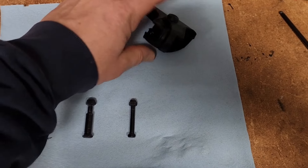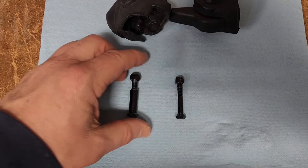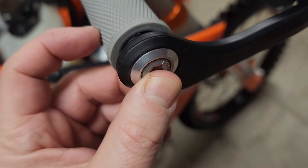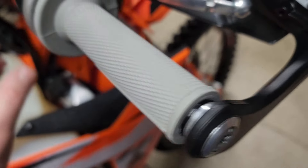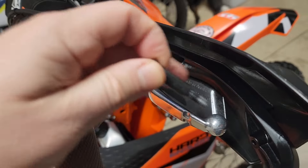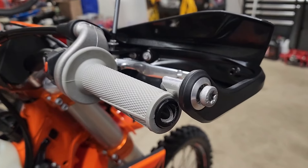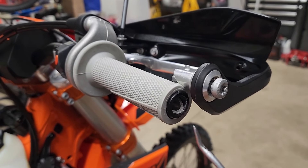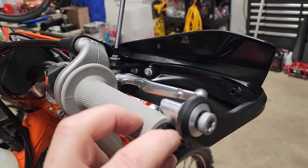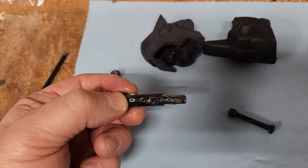Make sure you find your little rubber goodies that came with your bike — they'll usually be in a sack that came with the bike. Then there are the shorter bolts, because the longer bolts go on the perches that come on the bike. Now it's just a matter of taking these handguards off — we're going to take the perch bolt out, put the shorter bolt in, take this out and put the little caps in the end, then shift things around to accommodate the brackets for our new handguards. Here I am removing this bolt, and then after removing this handguard I'll put the thicker one in. Be sure to grease this bolt with some quality grease because it is a pivot point — grease it up before you put it in.